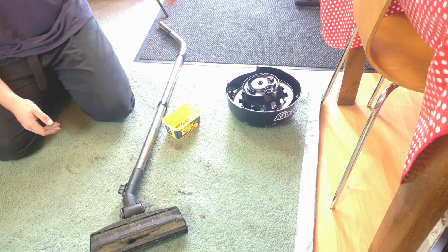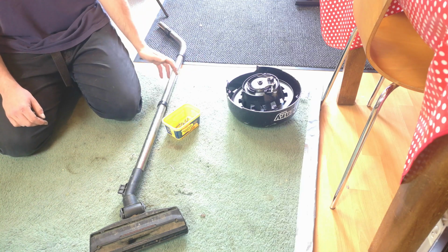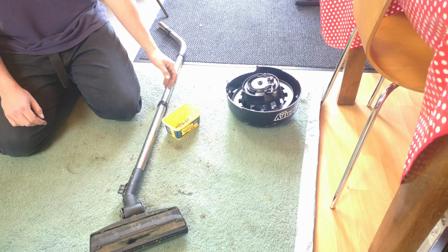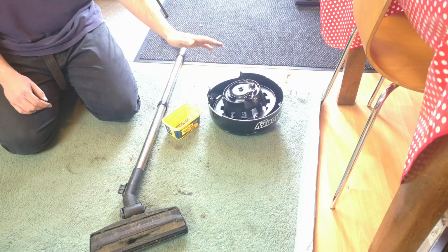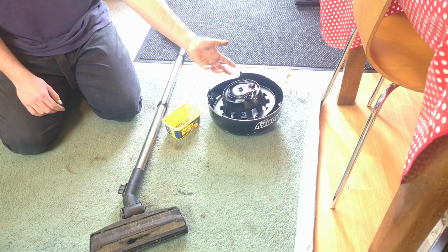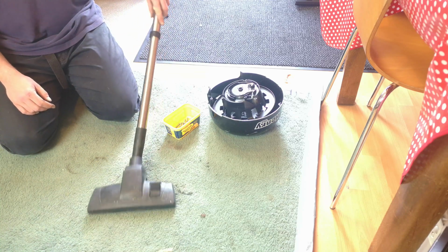What it was, looked outside, there's pine needles in it. I think it's just been used bagless, and then used as a wet vac and then left for a long time. I would imagine this is a 2018 model. If it's worked in the last 4 or 5 months, I'll be amazed. I think all it did was just blow its carbon off, or again got completely and utterly wet. Never use a Henry for wet.